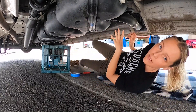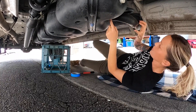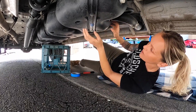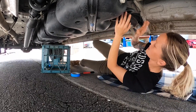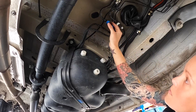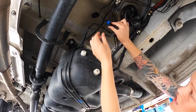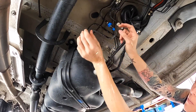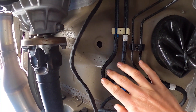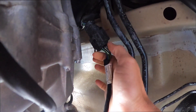You can undo the whole fuel cup assembly, but I feel that's not necessary. I like to just undo it here. We're going to loosen both of these off, loosen this one a little bit, take this one super loose and then pull it separate here. The reason I'm loosening both is so that when I take it down, I can tilt this upwards, because even though we got the tank down to empty and flashing, it's still going to have a little bit of fuel in there enough to be annoying. There are two other clips up here that we're going to undo - go sort of behind them and pinch, that little clip is going to come down and out, which then unlocks it and you just pull it off. A little bit of fuel is going to come out, but not too much. Then follow up and there's going to be an electrical connection - press the plug in there and then pull it off.